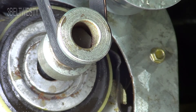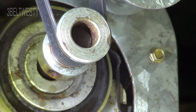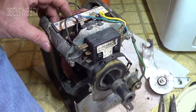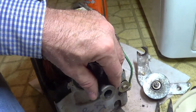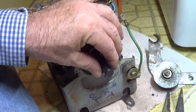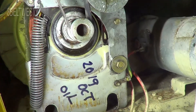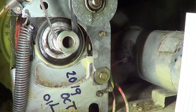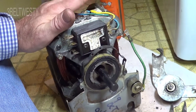With the door shut, we can see the shaft actually move on startup. Here's a hack you can use to get longer life out of a dryer motor on a clothes dryer. Many of them have a bushing. I've got the pulley off for clarity — this has got all sorts of wear, about the thickness of a credit card up and down but none sideways, because of the belt tension pushing on this motor. The shaft, due to the preload of the spring, is biased up, and that's why the belt is riding to the aft side.